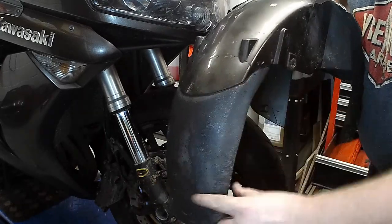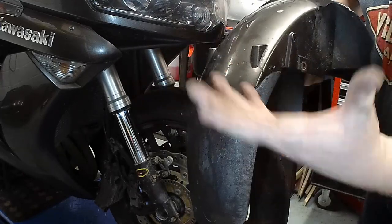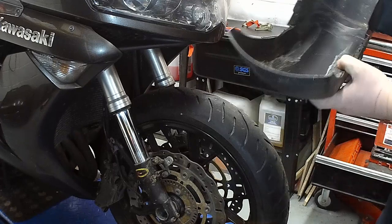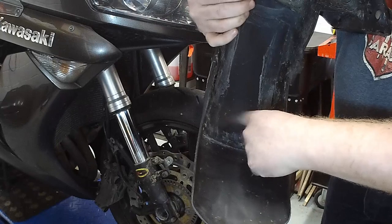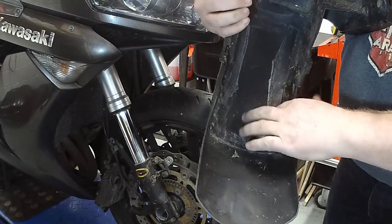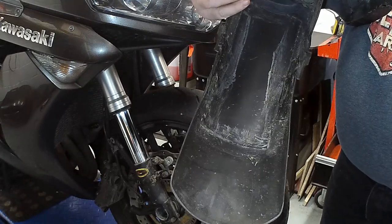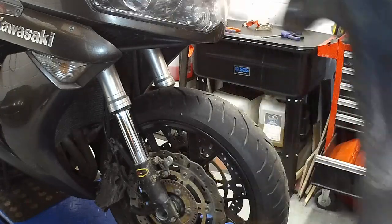So that's glued to that, that's longer, that's a fender extender, that causes that to be a bit more flexy, and then that cracked off. Fair dues, whatever. So to fix it, I got some old drain pipe, heated it up on the heat gun so it goes flat, and then PVC cemented it, like plumber's cement they use on water pipes, onto here. And this is the first time I've seen it back again, and is absolutely spot on. What a repair. Hey, MacGyvered the shit out of that. Perfect.